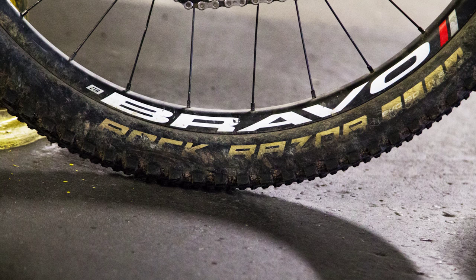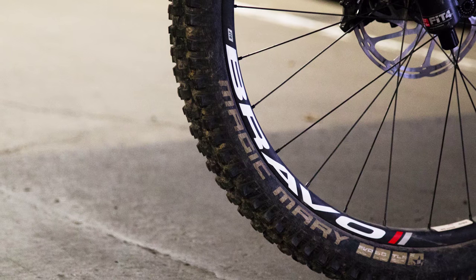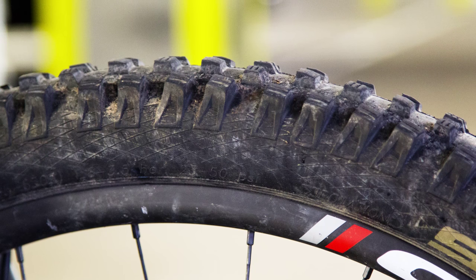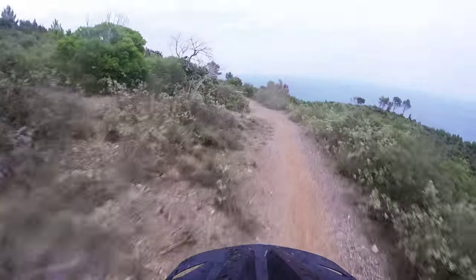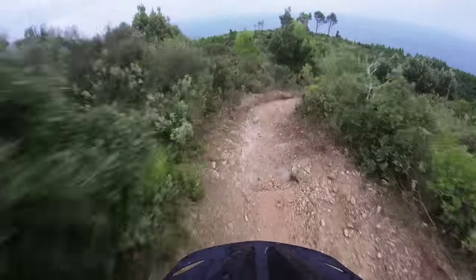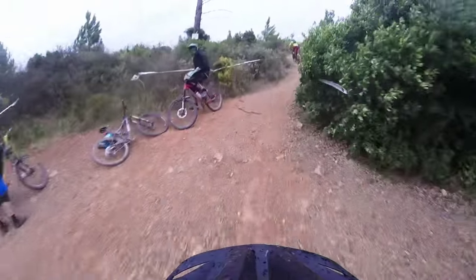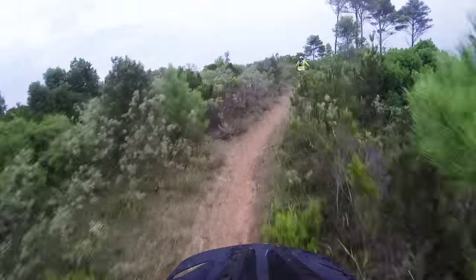To help with those rocks, I fitted a set of Super Gravity Schwalbe tyres. I've got a Rock Razor on the back, which is really fast rolling — not much damping, so in a straight line when you're hard on the brakes it does skip about quite a lot. But once you turn it into the corners, it grips really quite nicely. Up front is a Magic Mary, which grips really well in pretty much all conditions — from mud to sand and dust to rock. That combination saves you a lot of energy on the climbs when most of your weight is on the back wheel. On the descent you've got all that grip up front. A better-damped tyre like a Schwalbe Hans Dampf would have been a bit grippier on the descents, but it would have wasted energy on the climbs and traversy parts of the stages. So I think it's a pretty good combination.